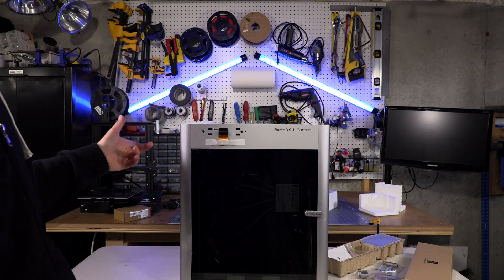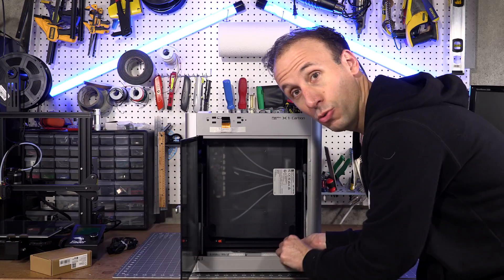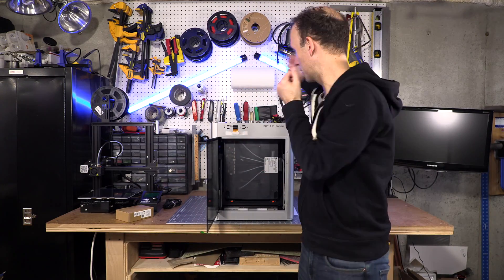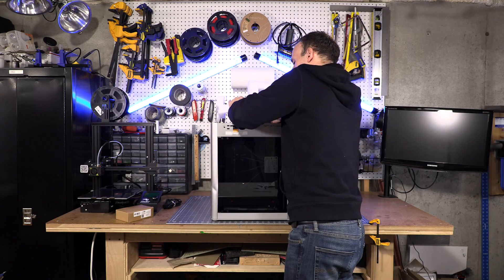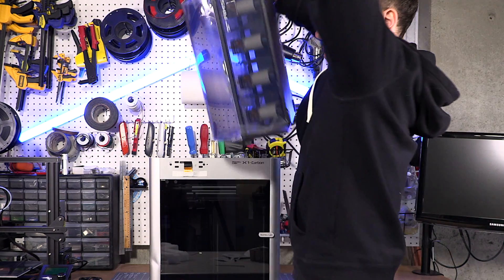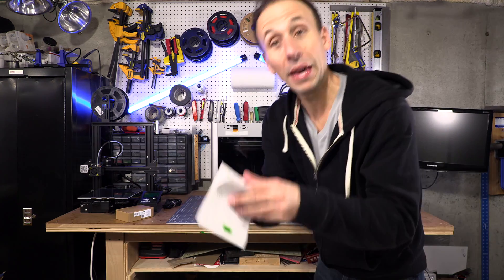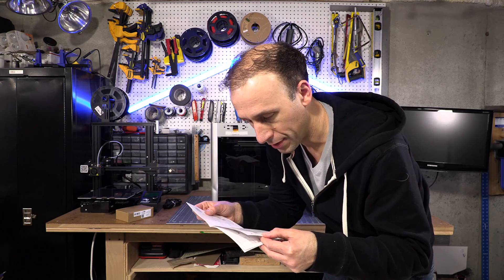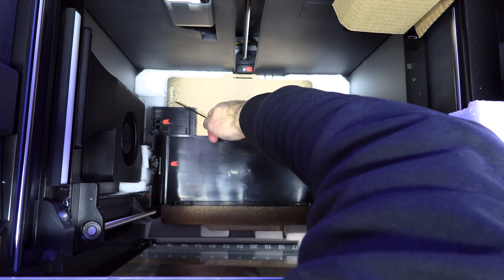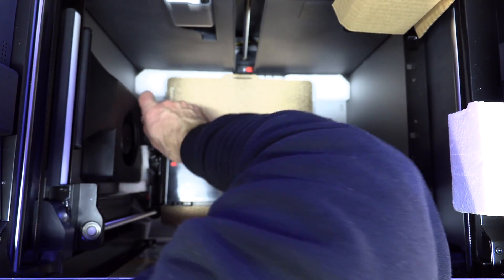Might be better to put it on my workbench. There are red arrows pointing to the two screws we need to remove — left loose, right tight. Now it should just come straight out once I undo those screws. Packaging out, comes right out. And there is the AMS. Now remove the four screws that the arrows indicate — the four screws that hold what they call the cushion, the AMS cushion, which supports it in shipping.